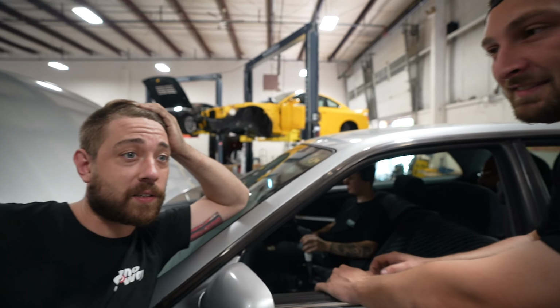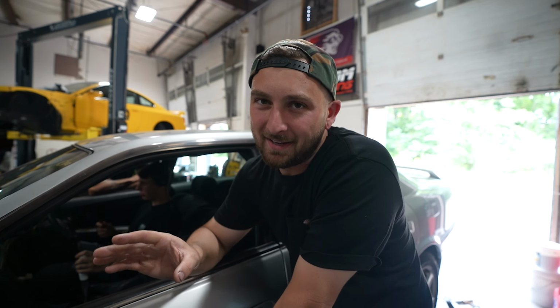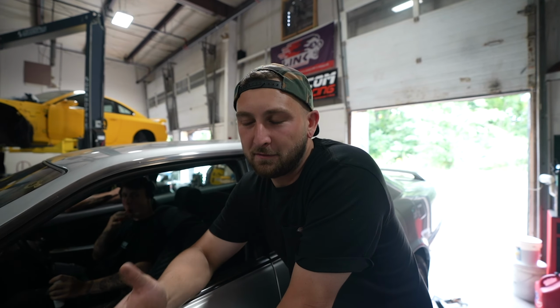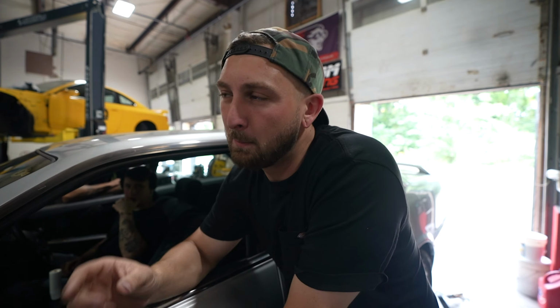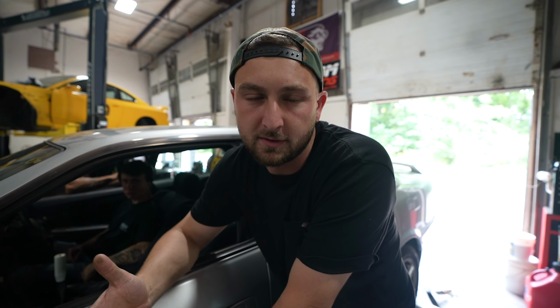I think you need 20 PSI. I'd love to, but I feel like that last 2 PSI is a gray area. The one Jay had doesn't flow the best. So you said that's the biggest downfall for this motor? Is the head. It doesn't flow as good as you would hope. The exhaust ports are very puny. They tend to get a lot of back pressure at the higher RPMs, at the higher power levels. For pump gas, when you get back pressure in the exhaust, it'll be more prone to detonation, and pump gas already is prone to detonation.